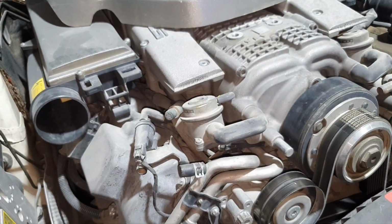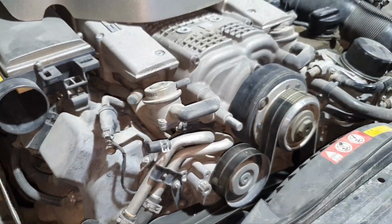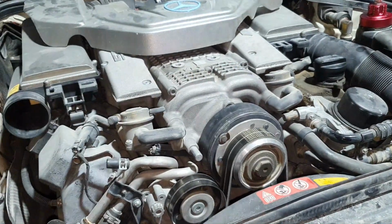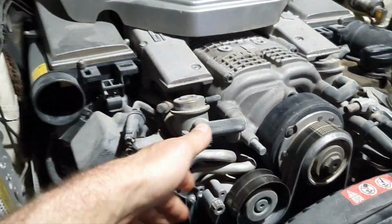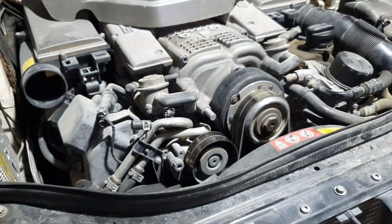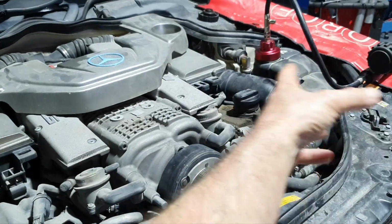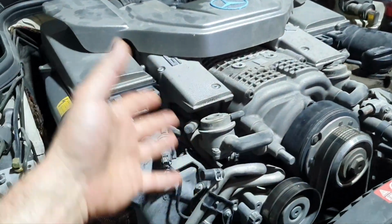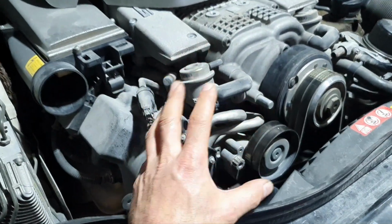I believe it's enough. You're doing 1, 2, 3, 5, 10 cars, let's say, sometimes it has to stop, right? It can go to somebody else. That's why I'm saying that. If you have a similar problem, you can go to any garage and fix that. You don't have to come here, you know? Just tell them to change for you the seals for the front timing cover. Most probably. You saw the test what I did, right? Okay, if they don't know, tell them, repeat this test, make a leak tester there, drain the oil and see if it's coming cooling down. 99% you are dealing with the seals. You have to deal with the seals.